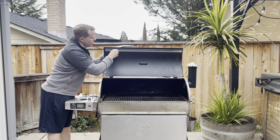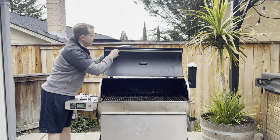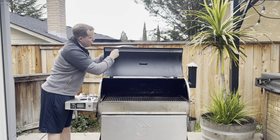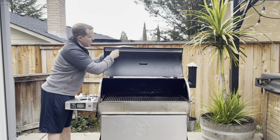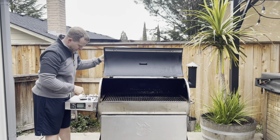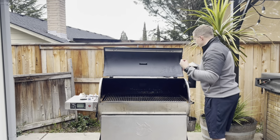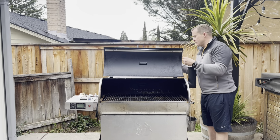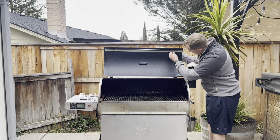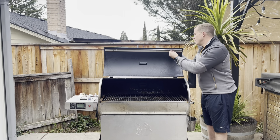And then you're just going to get a screw started through. I recommend doing one for each side initially. Be careful because those bullhorns, while you're getting them tightened up, if you just have one screw in them, it is possible for the bullhorns to rotate. You don't want them possibly to fall off or to scratch up the lid of your 700. By starting with one screw on each side, just make sure that you have that left and right spacing accurate. Slide this drip edge up just a little bit.